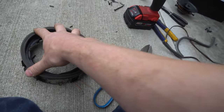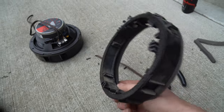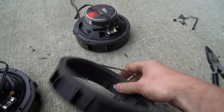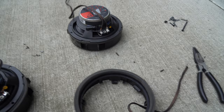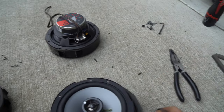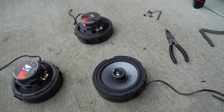We're gonna mount a speaker on here. I'll show you how after. So I've gone ahead and soldered on some pigtails. As you can see, this is all cleared up now. All we do is drill a hole in the side. That way you can pass your wire through, and you just go ahead and sink this through. I like to do this to keep it out away from the window that's actuating. And all you do is pull your tails through like that, and you'll have this like that.